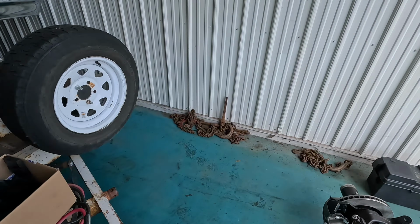Yeah, there was a spot on there that was starting to scare me that it was going to go too deep, but there's nothing to worry about there. I think what I might do is, I know I said I was going to do the oil pan next, but I think I might degrease these a little bit because I'm sure I was slinging power steering fluid on the other side. But I think I'm just going to go right to painting those, because I'm sure they're going to need two coats. So I'll get the first coat on, I'll start doing the oil pan, and then get the second coat on before I have to leave. So I'll just keep getting at it.